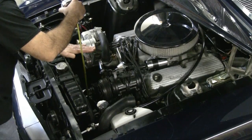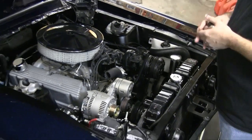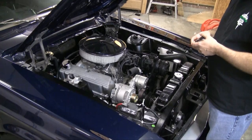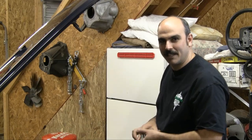I've got just about a foot above the center of the water pump. Some of the Fox Body Mustangs had serpentine systems. For Chevy guys, you can go to a third-gen Camaro — from right about 1988 and newer, they had serpentine systems. The Chrysler guys, from what we understand, are just going to have to deal with V-belts. Now where is Jeff? He should be back from getting that serpentine system by now.